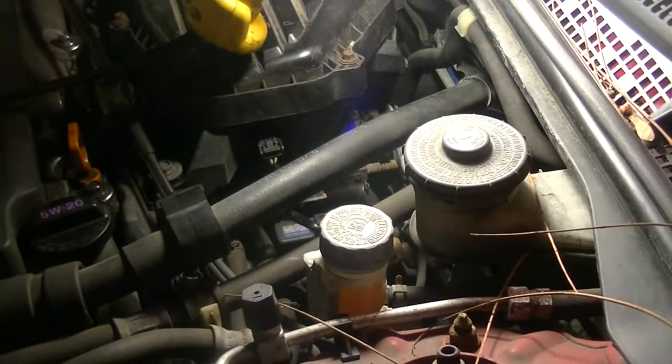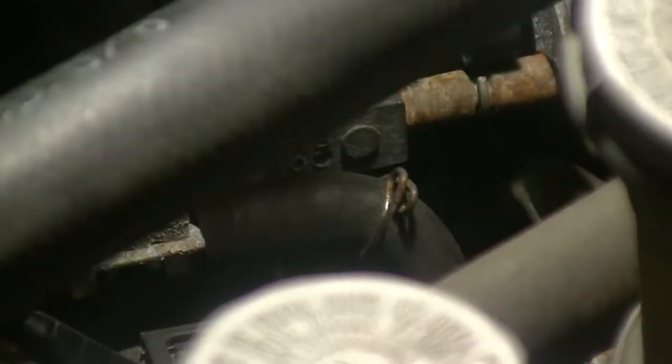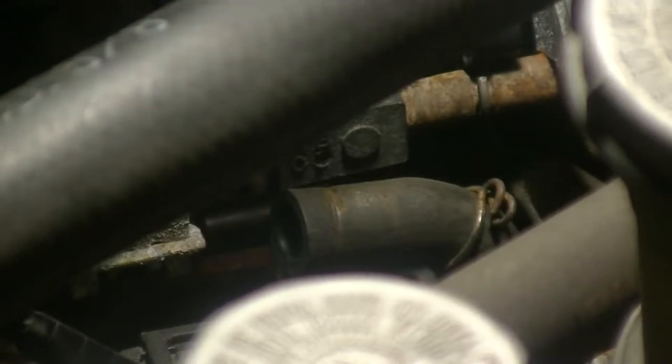When you read vacuum on an engine you want to pick a line that comes right from the intake manifold and is not some routed off line. So we're going to take this line right here in the middle. I already pulled back the little clamp holding it on, so we're going to take that off — that's the line we're going to tap to read vacuum. Just take our angle pliers here, take that off, and that's the line we're going to tap.